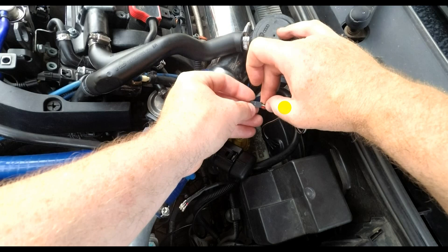So in the end I had to hardwire it. On this car, red goes to red, black goes to black, and white goes to white — the colors were the same. It's just that the white on the Glow Shift, Pro Sport, and Depo boost gauges is in the middle, whereas on the senders from AliExpress advertised for Defi and Greddy gauges, the red and black are together and the white is on the side.